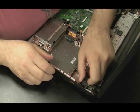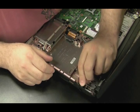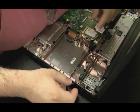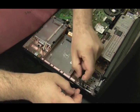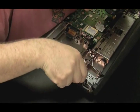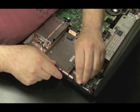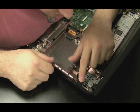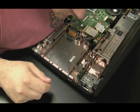Let's find out why that came apart in the first place. I'm going to try to fit it back in the proper spot — and it does fit, but a piece of the plastic that was holding it in there broke off on the left-hand side. So if you try to plug the power adapter back in, it's going to pop out again. We need to find a way to secure that jack. It slides in right where it should be, but only the right-side plastic is holding it in, so I need to fasten that jack so it doesn't move.